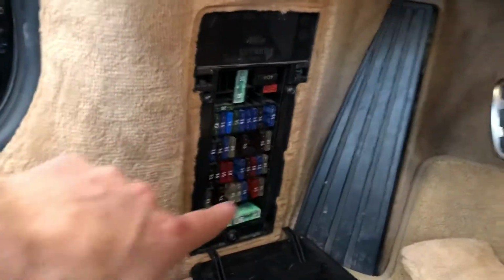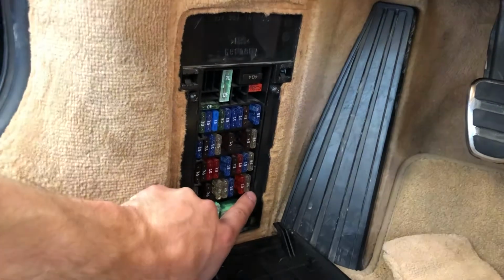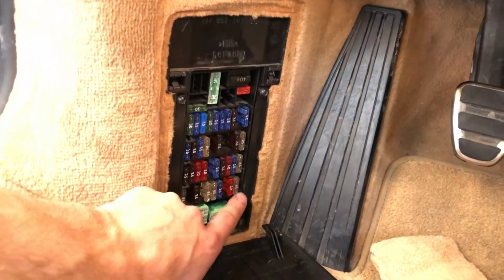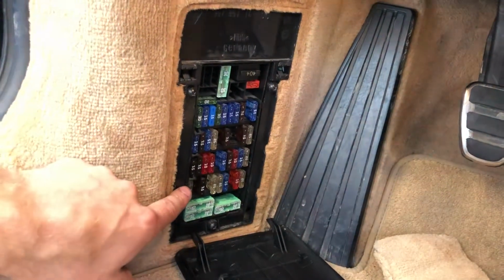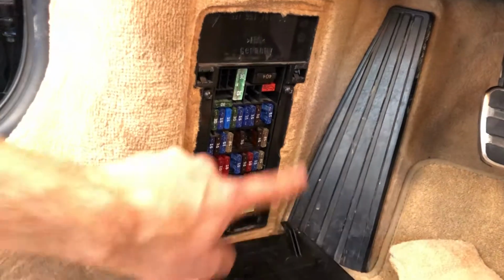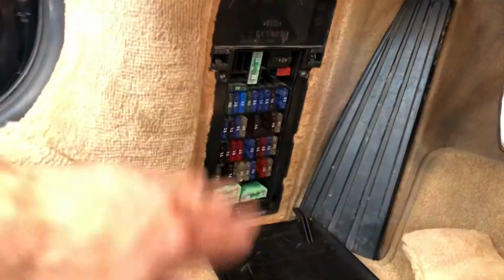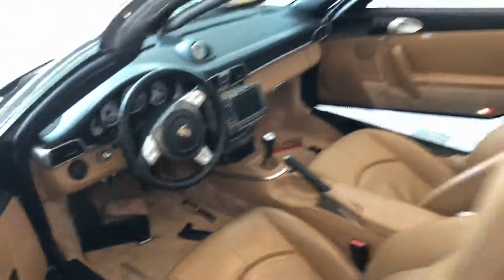So the first thing that I'm going to recommend you do is actually check your fuses down here. I have the Bose system. My number 25 fuse was blown, and I think that's like row, column D, like row 10. I'll put some links in the description of what fuse is what, but it's going to be a really good idea just to check all your fuses first and see if those are broken.